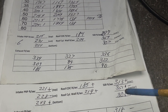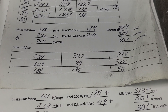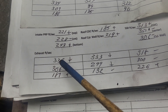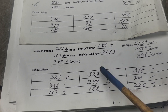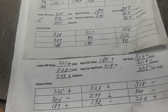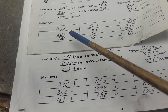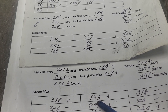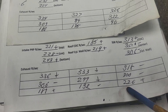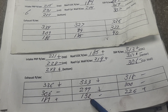That was taken at 600 — it was completely lost over the short side already at that point. Take a look at our exhaust speeds. Pretty much dead in the center, dead in this corner, this bottom is pretty bad. Did we improve it? Plus, plus, minus — we're not as even across as we were. But we're flowing a lot more air at 600 than we were here; before we were only 138, and at 600 we're 174, so we're moving a lot more air. That went down a tiny bit, but the center came alive — it was 89, almost dead, now it's 299, much better. This went down a touch, this went way up — compared to where it was, it was dead at 40. And this barely changed — it only went from 135 to 132.